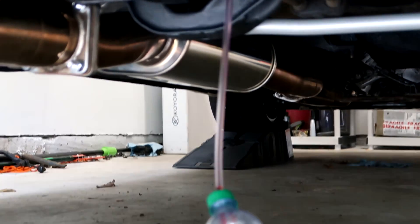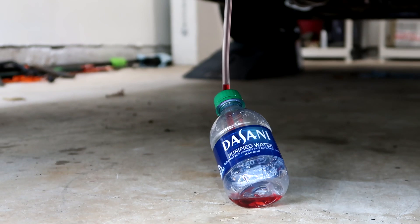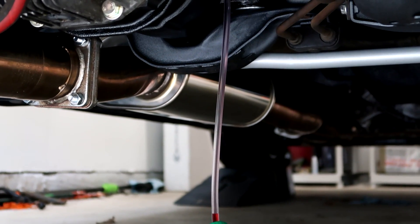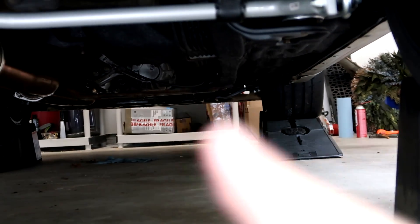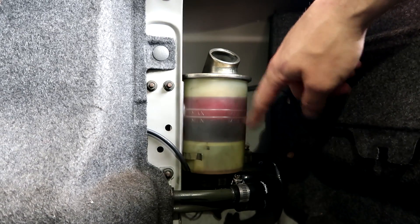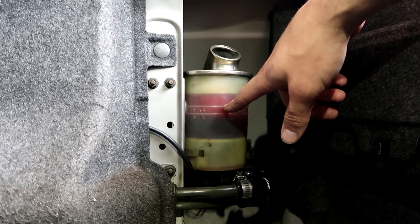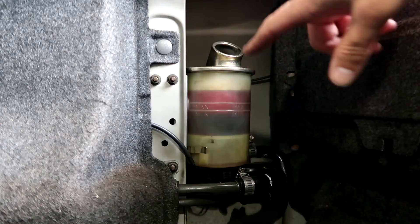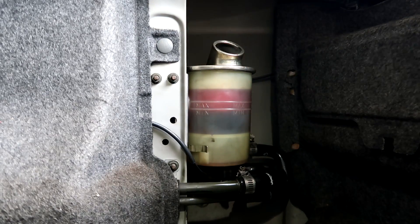You can see my setup and the fluid is starting to come out now, filling the bottle. I might actually burp it one more time, then fill the reservoir up to 30 millimeters above the max line, and then we'll start the bleeding procedure that goes all the way down at the transfer case. We've got the line of fluid above the max line. You're going to have to make trips back and forth to keep this filled up because it's eventually going to pump fluid all the way through and this level will drop, so I have to come back and keep an eye on it.